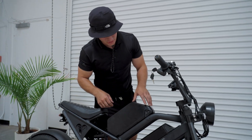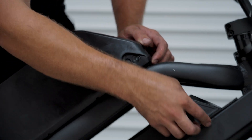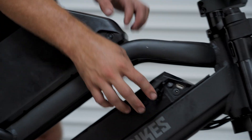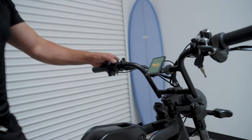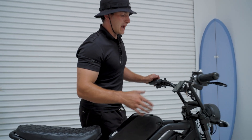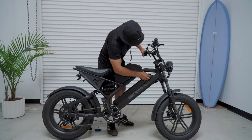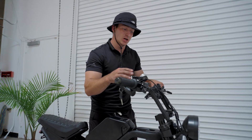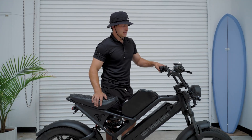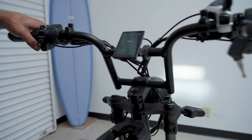One way we can test to make sure the battery is installed properly and working: make sure it is in the on position. Come to our bottom battery that was working before, turn that one off, then go ahead and turn the bike on. If the bike turns on, you know this new battery is working. To stay safe, I'd recommend turning the bike off again, turning on the other battery as well. Now we have two batteries hooked up and turned on — turn the bike back on, and there we go: we went from 40% and now we have 90% total with both batteries hooked up.